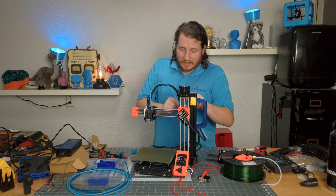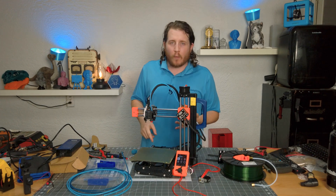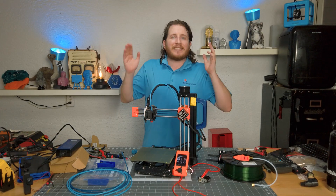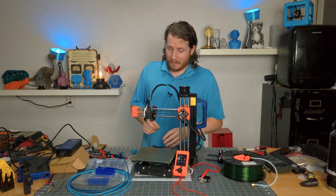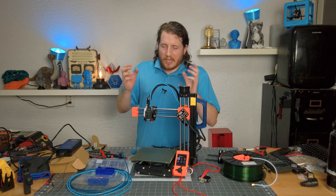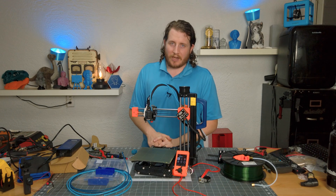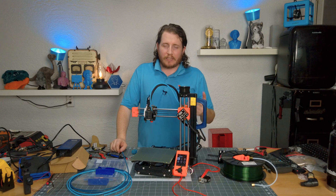If you throw a Revo on there and the Mad Monkey MM10 upgrade kit, you're changing barely anything — no soldering, no difficult wiring — and the entire system from E3D is easy to follow. When you put all of that together, this is a cheap upgrade. The E3D Revo system features an integrated thermistor and PTC heater elements, so it can only get so hot. To me, this is really where hot ends need to move in terms of technology.